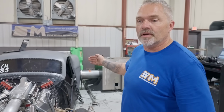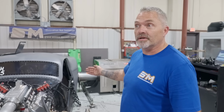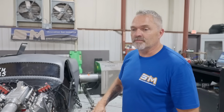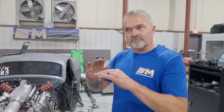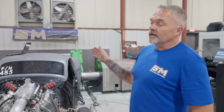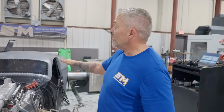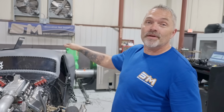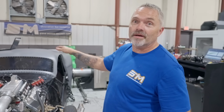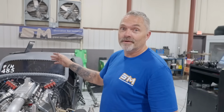If it had a 370 gear in it and it was spinning the dyno faster, it would be able to catch it better. And if it was building up gradually, like loading and then doing it, it would also catch it better. Now, this is also because of the way we're driving it. We're looking at the data log here, and he only went to 8,500 there, makes 63 pounds of boost at 8,500 RPM. It's going to be running 9,500, 9,600 RPM all the time. See what that makes.